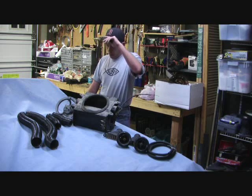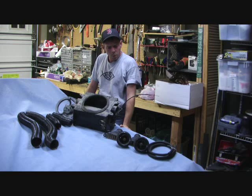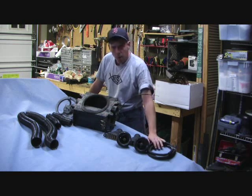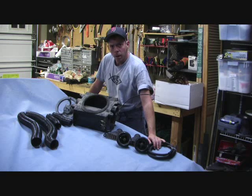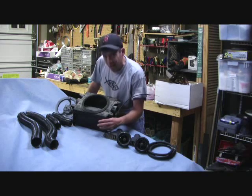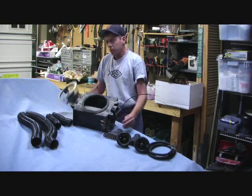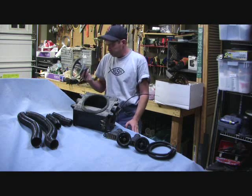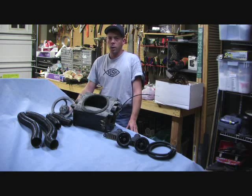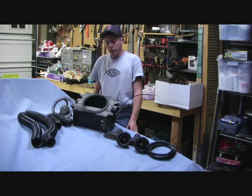What you've got in front of me here is the complete system. Your supply on the heater box runs off some hose off the back of the block, which supplies hot coolant into a radiator contained within the heater box. That radiator emits heat. Your fan, when operating, pushes air through the unit over the radiator, which then pushes air through the tubing into the interior of your car.